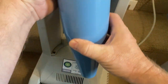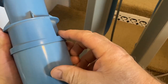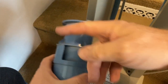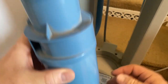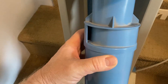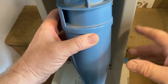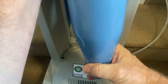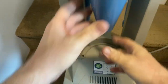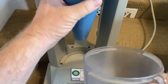This is the cyclonic — one of the other factors is that, particularly when you're in a home where you can pick up a lot of dog or cat hair, this cyclonic component that pops up inside here has a tendency to clog up pretty easily. You can be vacuuming away and not even realize it's happened, and then it starts to bypass and goes into the filter, which constricts the flow. It's a good idea, it's just the application of it is flawed.